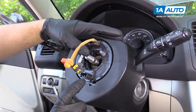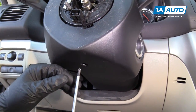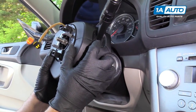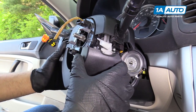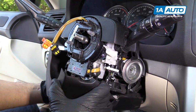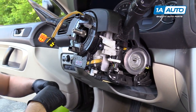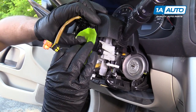Next, we're going to take this cover off — just make sure you keep your hand up here so this doesn't spin. Once we get this off, we'll tape it. There's a Phillips head screw right here; I'm going to use a Phillips head screwdriver. I'm going to lower the adjuster down so that I can get this cover off and slide it right out. While I'm at this point, I'm just going to tape this so that it won't spin — take a piece of tape and that'll hold it from spinning.